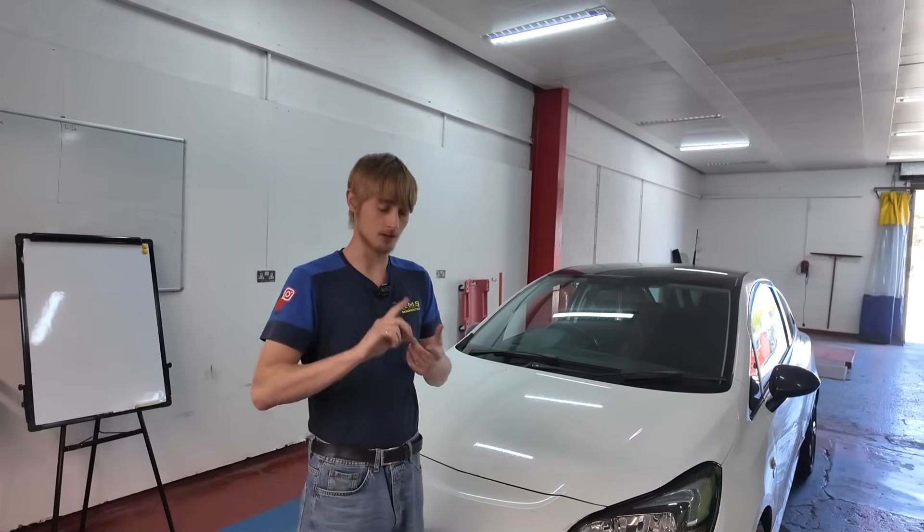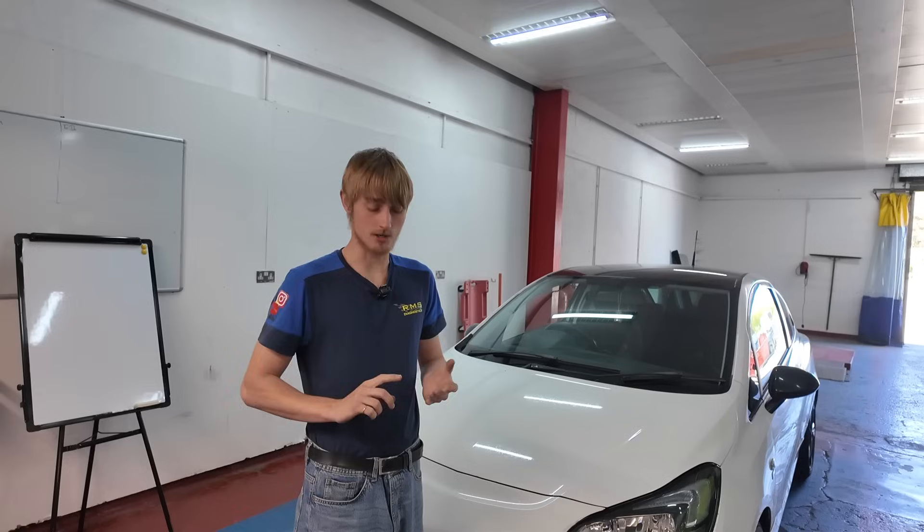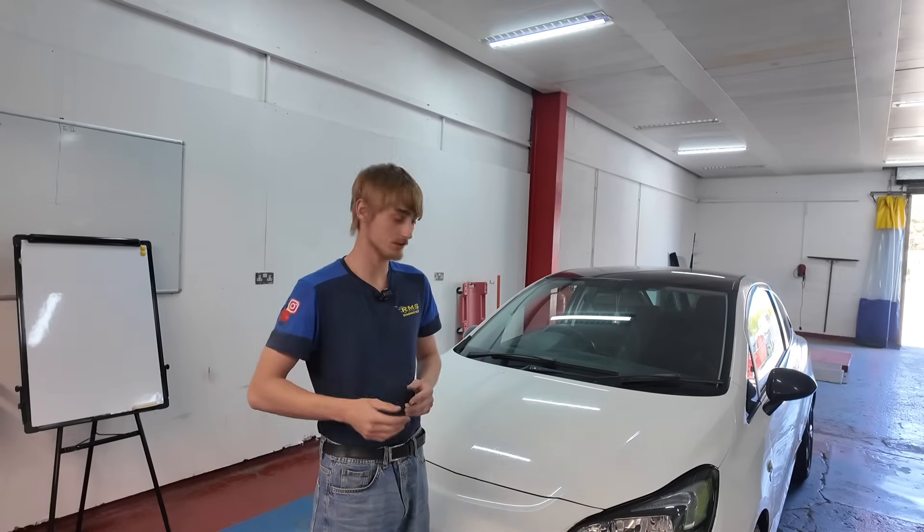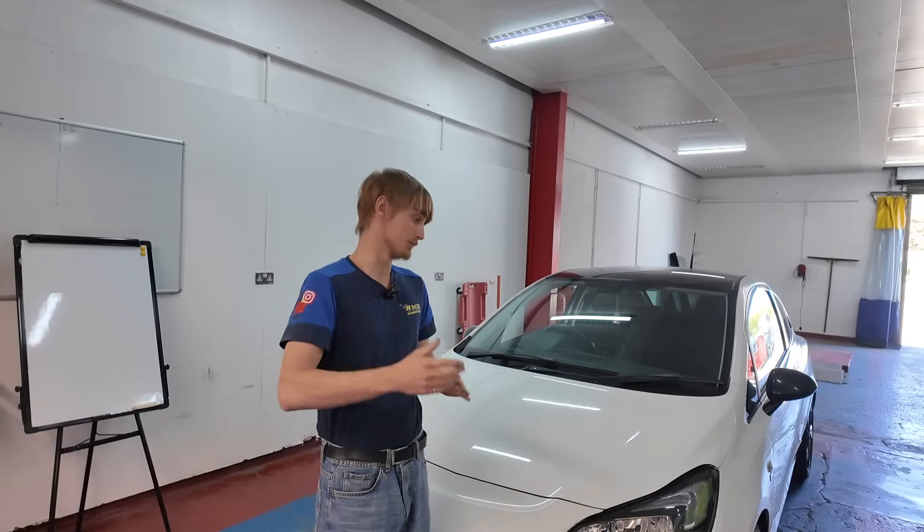All four settings are showing different brightnesses. With it off: 12 volts. Speed one: 2 volts. Speed three — there we go — and number four is full earth going all the way through. So that's proved our diode is good, wiring is all good, and the resistor is fine. It's literally just the blower motor now. Unfortunately when resistors fail, everyone runs it on setting four where it still works because it bypasses the resistor, but it burns the plug out, burns the wiring, and does the fan no good with full power all the time.